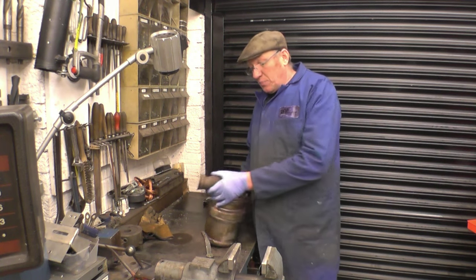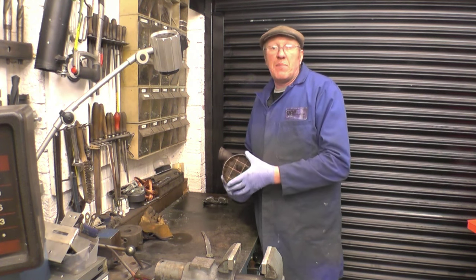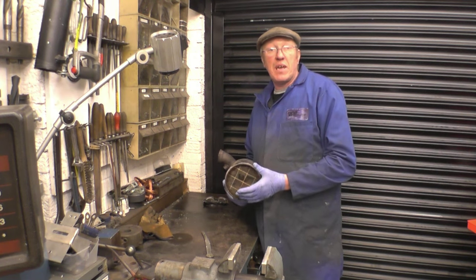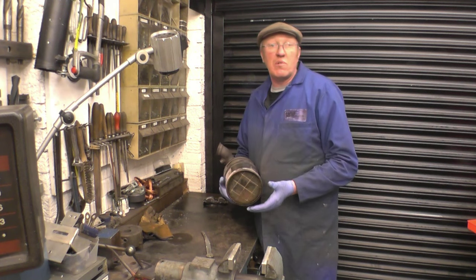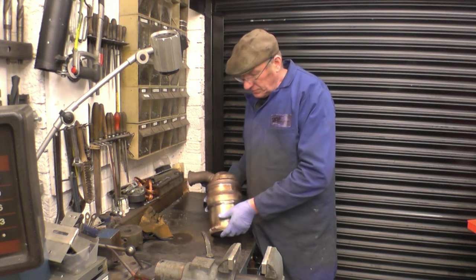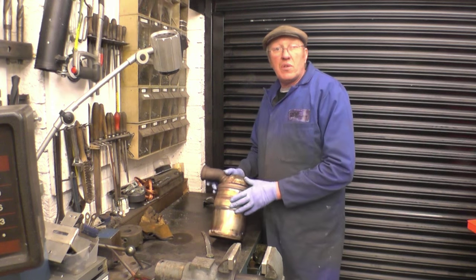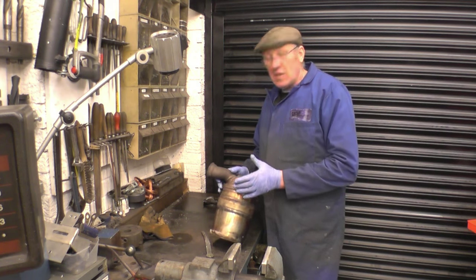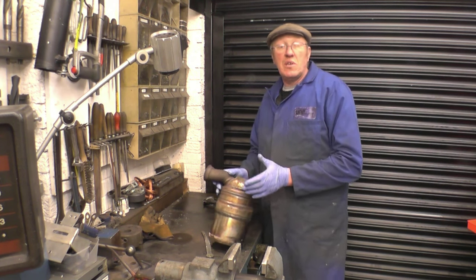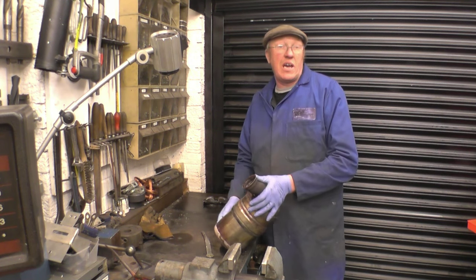What I'm trying to do is put a device like this on to clean up the exhaust. After the DPF there's also a cat — a catalytic converter — which converts the exhaust gas to remove some of the nasties. Using the correct engine oil is very important; you must use a low-ash oil designed for engines with DPFs fitted. DPFs aren't going to go away — they're going to get worse. Diesel emission regulations are going to become stronger and stronger. It's just the society we live in.